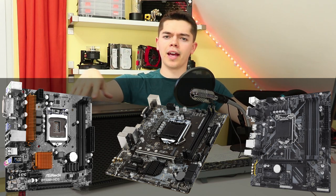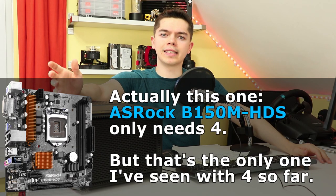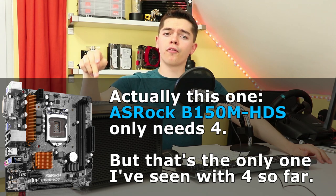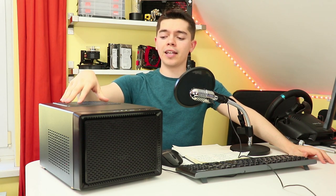Plus, going on from that, when you have a 226mm tall board, how many standoffs do you support that with? Well, normally six, and pretty much in every case of that size I haven't seen one yet where you don't need six standoffs. This will only support four, which are the four predominant ones for Mini ITX motherboards. So it doesn't even have the six that would support the maximum motherboard standard, Micro ATX, that it can support. So that's a huge issue there. Moving on from that, there are only two PCI Express slots to the rear.